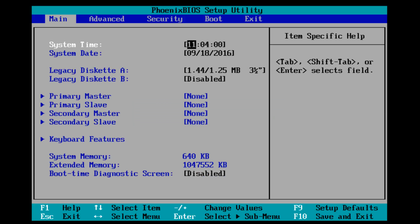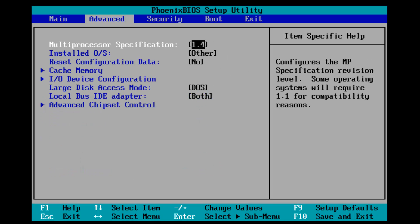So you have to make sure you type the password correctly. Just make sure you remember what your BIOS password is and keep it in a secure location, because resetting your BIOS password can be a little bit annoying — in most cases you have to take apart your computer. You'd have to open up your computer case, and that's always a pain. I highly recommend you keep this password in a secure location, as it's not exceptionally easy to reset it.